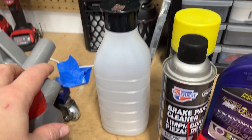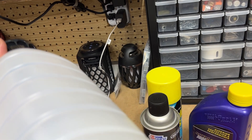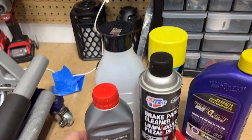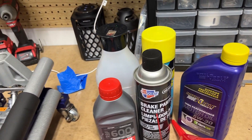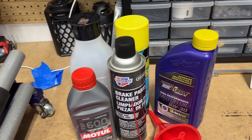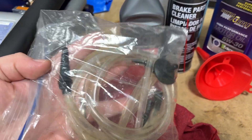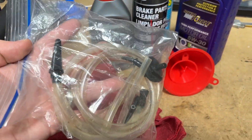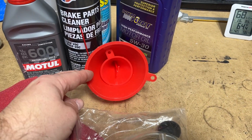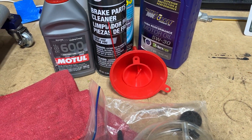When I first did my brake job, this container was just what was in the recycling — drilled a hole and that's pretty much it. But I'll probably just make it smaller, because if I'm just bleeding at the track and not doing a whole flush, I don't need full volume. With brake bleeding, I have a little Ziploc bag of different hoses and adapters to facilitate the bleed, plus some funnels to help pour in fluid as needed.